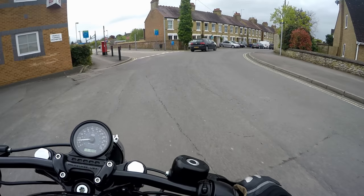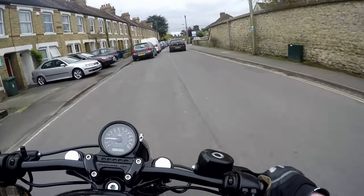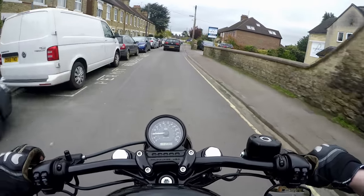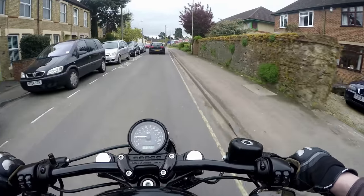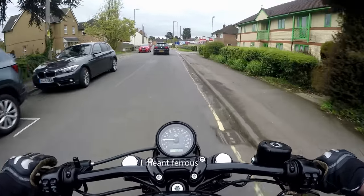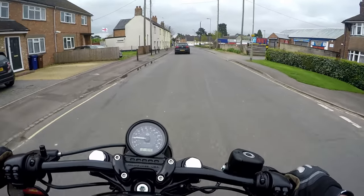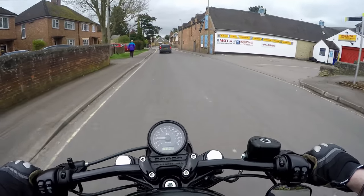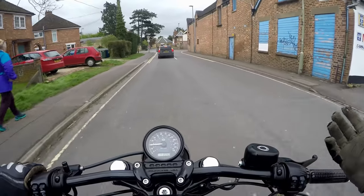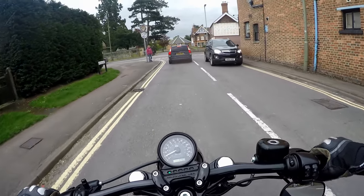Basically, in a nutshell, there is a small sensor that sits by the kickstand. When the kickstand is up, there's a little metal plate that covers that sensor, and the sensor detects ferrous material — I can't actually remember the name of the type of switch. If it's close to magnetic metal, the switch enables you to pull away in first gear. If it can't detect that, it assumes the side stand is down and it's going to cut out.